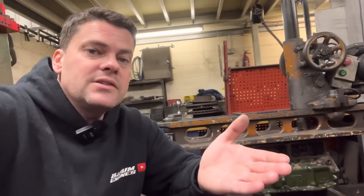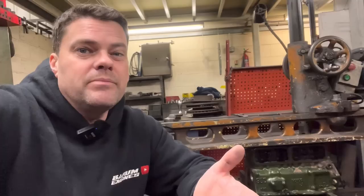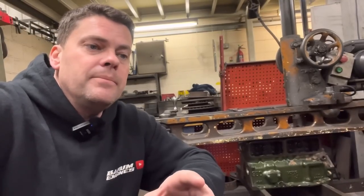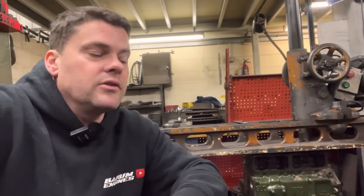We have to be very careful about what we machine to what sizes before we find out what parts are available. On this one we'll measure it first, see what sizes are available, and then know what to bore to — we won't just bore until it cleans at a particular size and then find the parts aren't available. At the moment it's almost as much of a pain as trying to get parts for a rare engine. If you've got a more common engine and think there'll be loads of bits — even if the website shows stock available, make sure you ring them up, because a lot of the time right now they're going out of stock faster than the websites get updated.